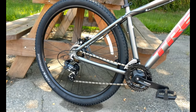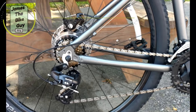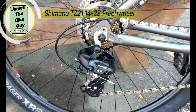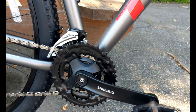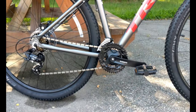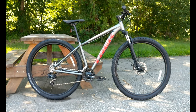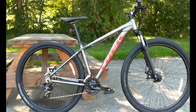The bike is set up with a Shimano Tourney 7-speed drivetrain. That's a Shimano Tourney rear derailleur running through a Shimano TZ21 14-28 7-speed freewheel, and up front a Shimano Tourney front derailleur through a Shimano Tourney TY301 crankset in a 42/34/22. This drivetrain gives you enough harder gears for commuting on a bike path or in the city, plus climbing gears for going off-road.